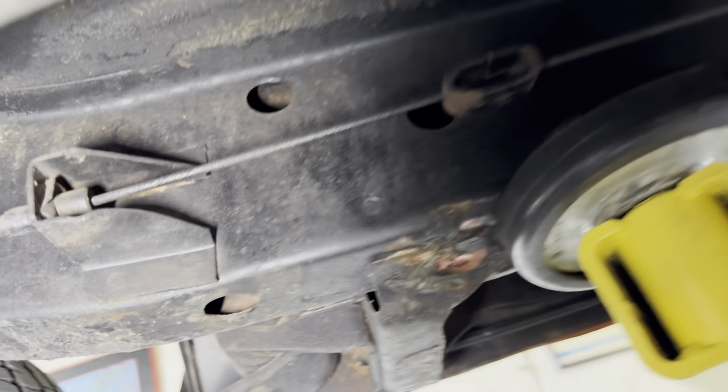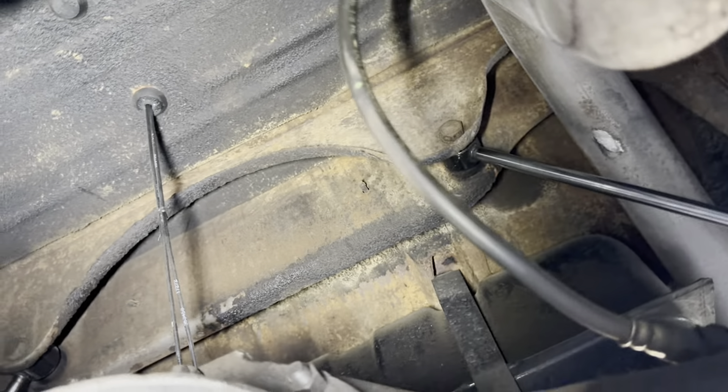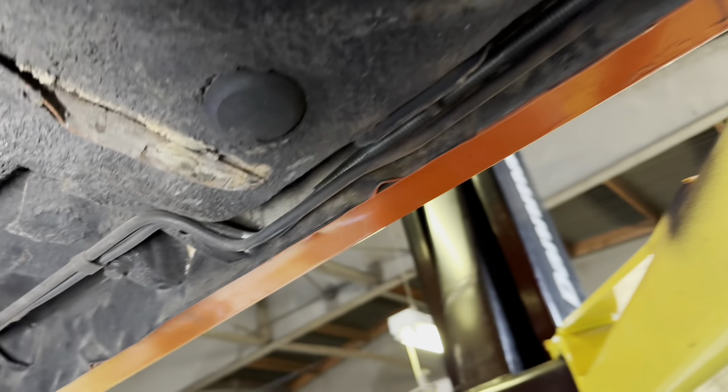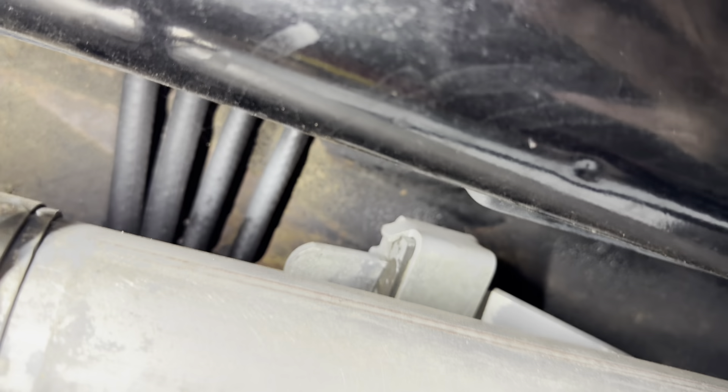There might be some repairs in there. I brought my paint gauge too - I'll show you how to use that, it tells you a lot. Everything looks good underneath here, I don't see anything scary. This is pretty much exactly what I expected. The dealership was pretty good, provided some good photos and seems pretty honest. I don't really see any major problems underneath - a couple of things, like the exhaust is actually hitting the shock where it wasn't routed well. For a survivor OE car I'd go more in depth on leaf spring part numbers, but we're just looking to make sure it's solid and not a super rusty east coast car.